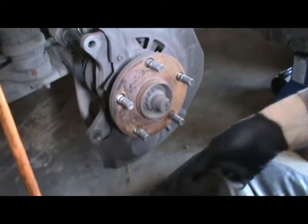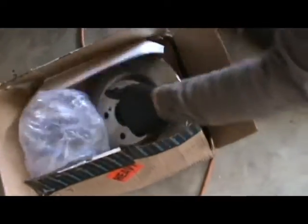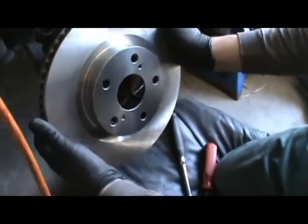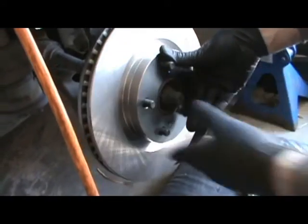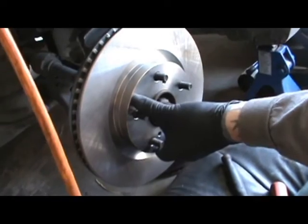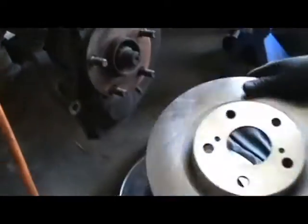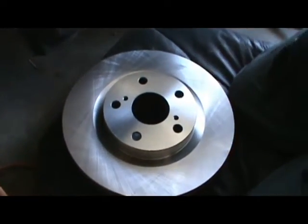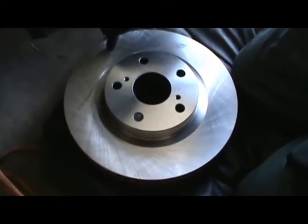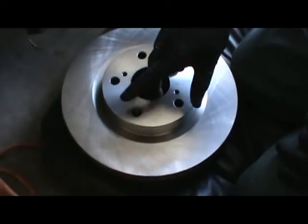And what we're gonna do is get the new rotors and put those out of the way. And I got a new rotor. First of all, let's make sure they work. That's one reason that it's good not to be banging on that old rotor. So you notice this new rotor just, you know, we'll just compare the two. Now, one thing about this new rotor is it has a coating on it. You notice it's not rusted. If you leave metal that's been finely ground like this out, within 2 hours, even in just a heated area, it's gonna start rusting.